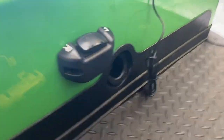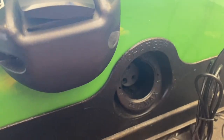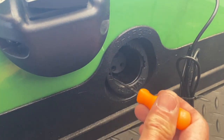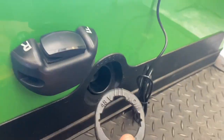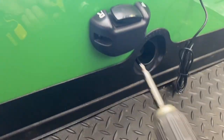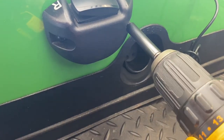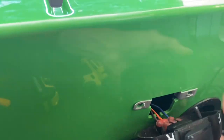The next step is to take the body up a little bit. We're going to take this cover off of the charging port. What I use is a little pick sticking in the side — squeeze it to the outside and that'll come right off. Save that. Next step is the forward and reverse switch, T25. Take that off. Save your screws.